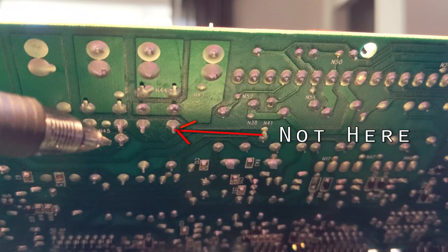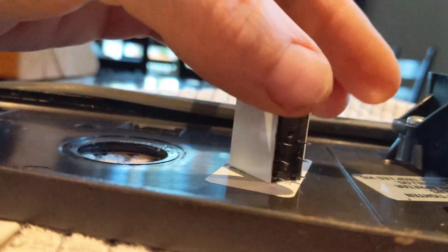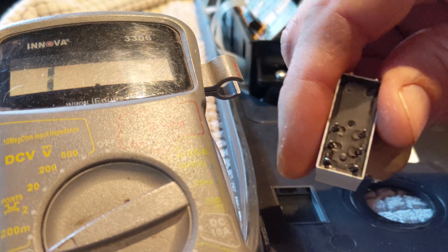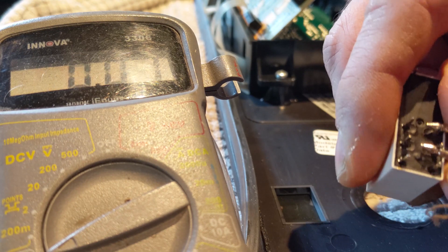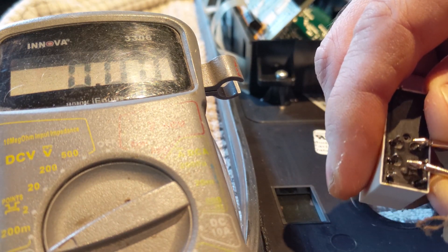What I've done is I purchased a new relay. This was $6 shipped from eBay. Here we've got our relay and we're going to measure between those two terminals on our brand-new relay. We can see that sure enough, those two are connected. This is a pretty fun one because I think it's kind of crazy that with such a simple problem like this, someone is ready to just throw away the stove — a thousand-dollar stove.